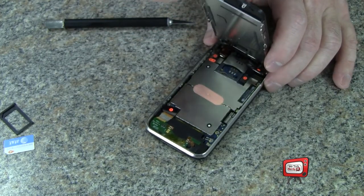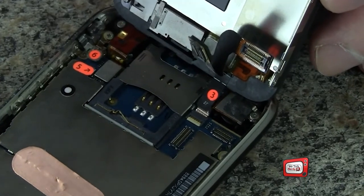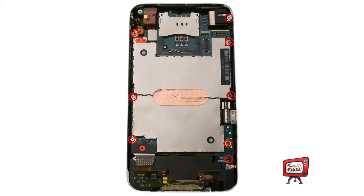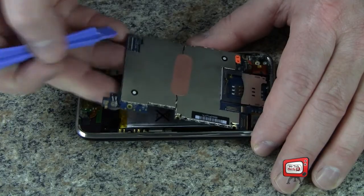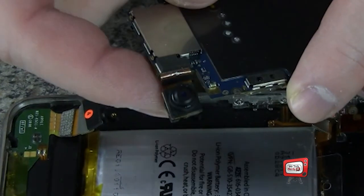Lift the panel up from the dock end, being careful not to tear or break any of the ribbons connected near the other end. Simply unplug ribbons one and two by gently lifting them from the main board with your plastic tool. Underneath ribbon two, you will need to find and unclip ribbon three, and then carefully remove the display and set it aside. Remove the eight screws as indicated in this image. One of the screws is located underneath a sticker that says "do not remove" — you can just peel away the little sticker and remove that screw. The screw in the upper right-hand corner attaches the camera to the housing with a small clip — be sure not to lose the little clip. Next, unplug cable four and then gently lift the main board out. The camera will still be attached to the main board with a small ribbon cable — be careful that you don't pull it free, but if it does come loose, it has a little plug connector that you can just plug back in.